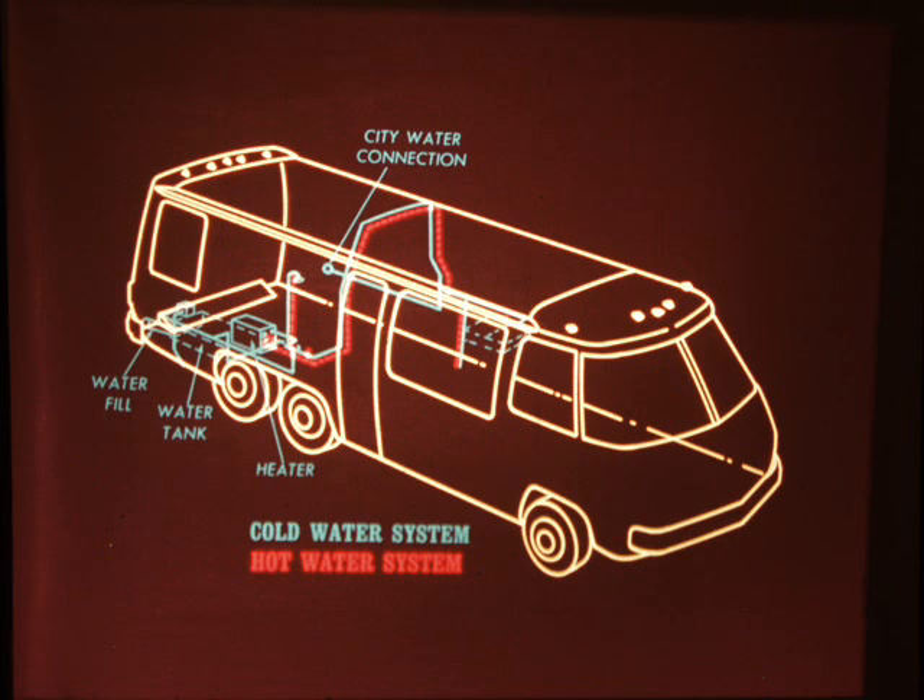This drawing illustrates the water system layout of the 26-foot model. The motorhome's fresh water system has two sources of supply: the 40-gallon supply tank at the rear, or direct connection through a hose attachment to a city water system. The connection on the driver's side is where city water is hooked up. Because city water has higher pressure, the water pump functions as a check valve that closes off the tank to the city system. The supply tank is not filled from the city water connection — instead, the tank is filled through its own filler, located in the LP gas compartment on the passenger's side.